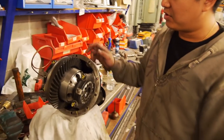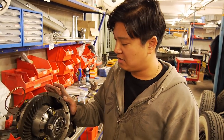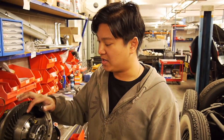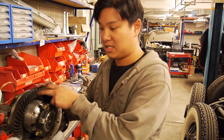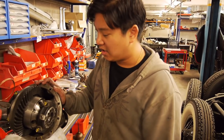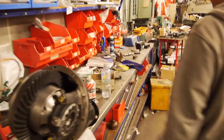There you are. Final comments, it's a brand new gear set, so run good oil, and change it after it's run in. Not too much crazy stuff until it's bedded in. One last check, which we do need to do, is paint the teeth and get a pattern. And should we do that now quickly? Absolutely. Yeah. And regardless of the pattern, I'm still going to sleep soon.